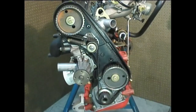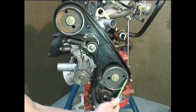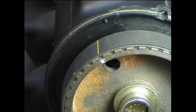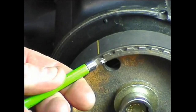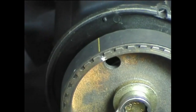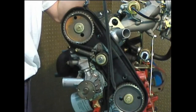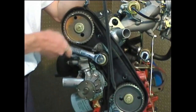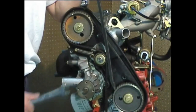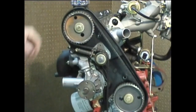The next step is to find the three marks used for indexing the timing belt: the camshaft, the intermediate shaft, and the crankshaft. Line up the camshaft gear dimple — which we've painted white — with the corresponding rib on the rear of the timing cover. You may need to rotate the engine slightly to bring the two into alignment. Then compress the tensioner to relieve tension off the belt for removal: loosen the nut, press the tensioner toward the center of the engine against the tensioner spring, tighten the nut back up, and remove the belt.